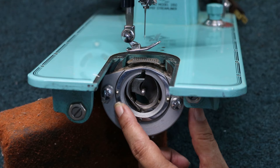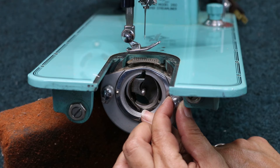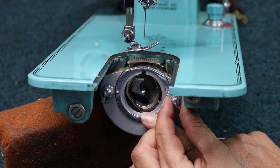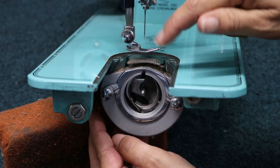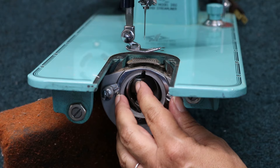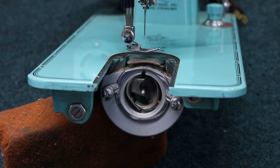Otherwise it's not going to sit nicely. Now this one, I have to turn this dial and get that little piece there on top of this race cover — just like that. And then coming around — there we go. So they're all basically the same. Whether you have what they call a side load or a front load, anyone that oscillates back and forth — meaning that it's rocking back and forth — you're going to install them just like that.